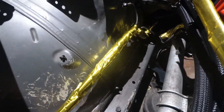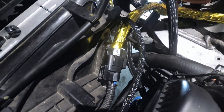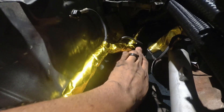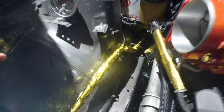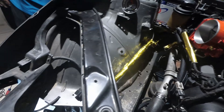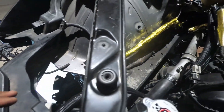So we've actually finished successfully wrapping everything. When you're doing the wrap, you want to get all the way up as high as you possibly can — you can see we wrapped every last bit of this all the way to the fan connector. Now, we noticed something funny: you see this? This is a brake line. When you try and pull the harness up here, it kind of pulls down on it and makes it nice and taut — we don't really want to do that. So we're going to disconnect this entire harness from the fan, disconnect it from the wheel speed sensor, and run this entire harness underneath and back over the top.